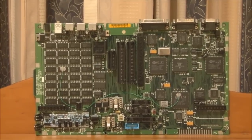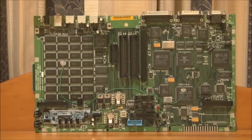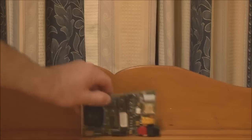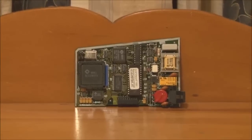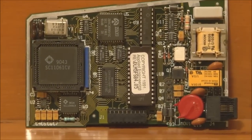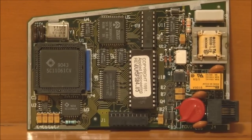Let's have a quick look at the modem card that came with it. This would have been a standard 2400 baud modem — for 1989, about the best you could get. How times have changed. We've got a clock crystal, some control chips, a line transformer, relays, a connector for the phone jack, and this is the ROM marked 'copyright 1991 Applied Engineering,' with the connector down here that interfaces with the portable's logic board.